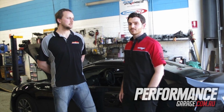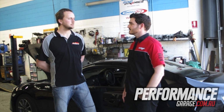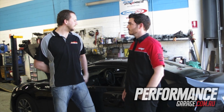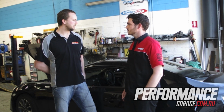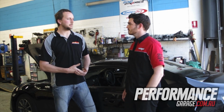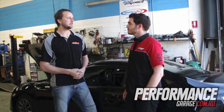This is Scott from Haltech. We're just going to have a chat with Scott. Just wanted to know basically why you would run Haltech in this situation rather than sticking with the factory ECU. For sure. In the case of the 86, the factory airflow meter does run out quite early. This car being turbocharged, using the Haltech gives a lot more load points, so you can actually tune the fuel and ignition as you're supposed to.